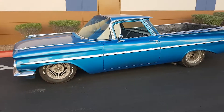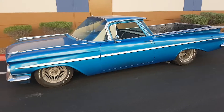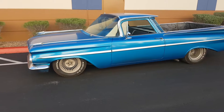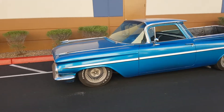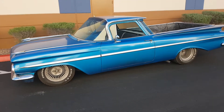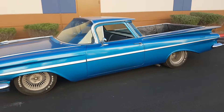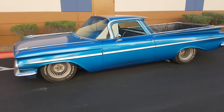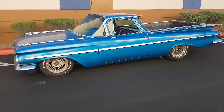We just did that for demonstration, but normally you'd use a tape measure. The best method I find is to work with the heavy end first — so for this car I would air out the back and then set the front heights so they're even, raise the back of the car up, and once I'm happy with my ride position I'd press and hold 'ride' to save it, then go and do the other two settings. I find that's always the best method to get your pressures fairly even as well. If you run into any issues, you can get us on Instagram or Facebook.